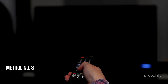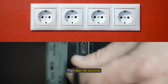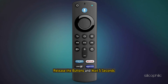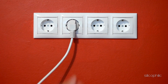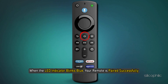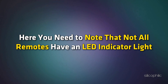Method 8: Reset the Fire TV Remote. Unplug your Fire TV from the power supply and HDMI input and wait 60 seconds. Press and hold the left, menu, and back buttons simultaneously for about 12 seconds. Release the buttons and wait 5 seconds. Remove the batteries from your remote. Plug in your Fire TV and wait until you see the screen indicating the remote cannot be detected. Reinsert the batteries, then press the home button. When the LED indicator blinks blue, your remote is paired successfully. If not, press the home button for 10 seconds. Note that not all remotes have an LED indicator light.